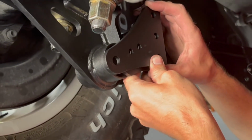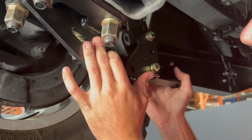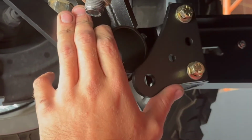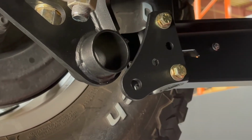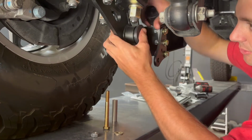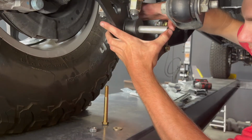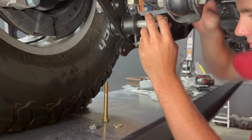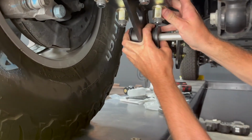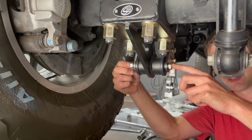You can see the long plate was almost at the rear of, past the rear of the bushing holder. The front plate's pretty close to center line. The short plate here, so it's going to be a little easier to just push this backwards with the short plate. So now at the back here, we've pretty much got the middle of the hole lined up. So we're going to press in our 2 bushings, and then our aluminum piece will go down the middle here. I'm just going to use the screw to help push on this. There it goes.